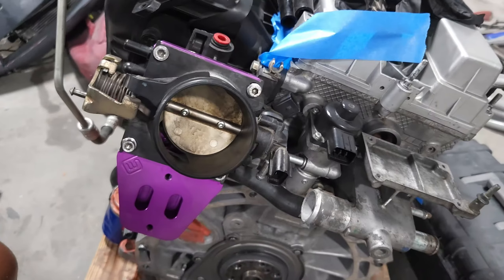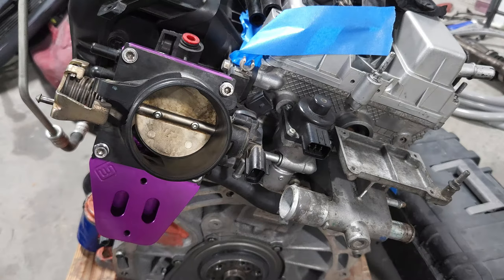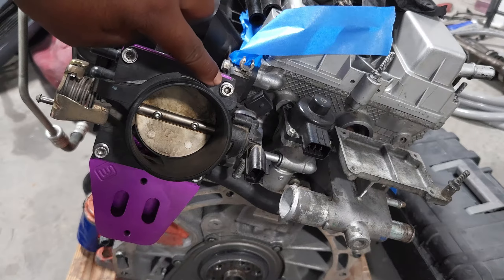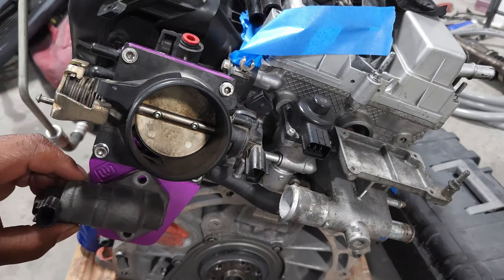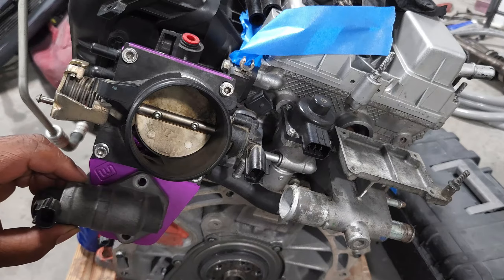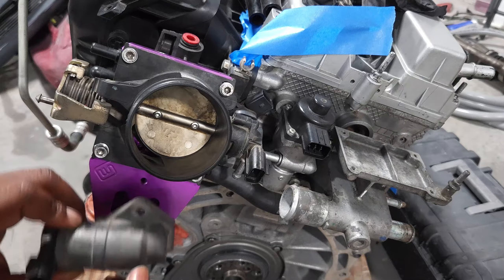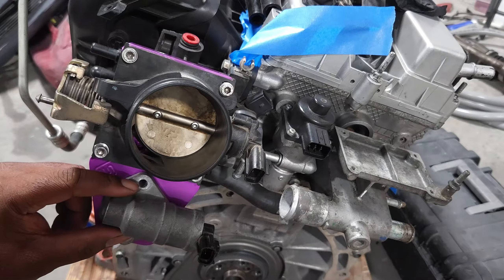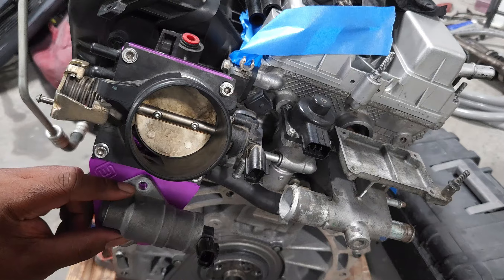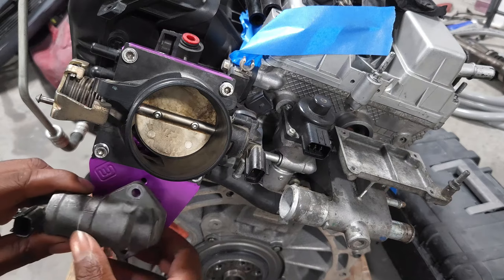There you have it — got the install done with four screws in place, due to this race being pressed out or drilled out. I didn't have any luck pressing it out; I had to drill it out, so your results may vary. Now you have enough room to clear the throttle body or the EGR. You may be able to set it this way, but there may be something like the transmission in the way, so you have to get these two together to see if you can fit this on in this location.